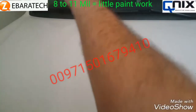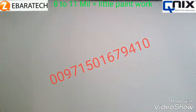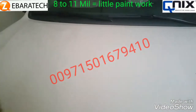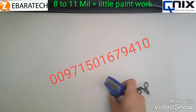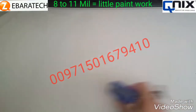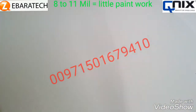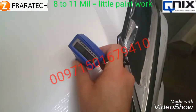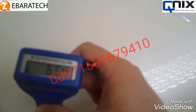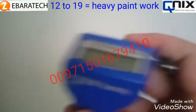What I've done is divided the bonnet into two halves — this half and this half should be symmetrical. Wherever I check one side, I should find the same reading on the other. It's showing seven here, seven there. Here it's six-point-five, and the other side is also six-point-five — exactly the same. That means this is original paint.